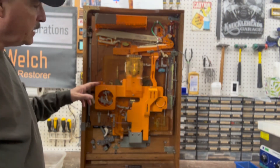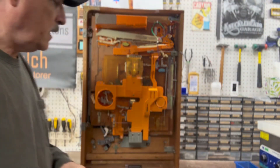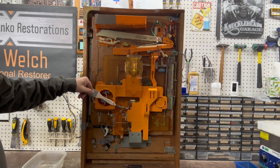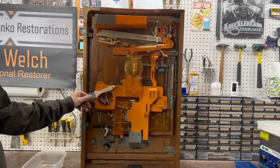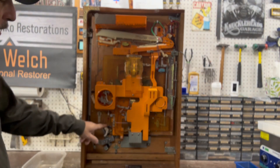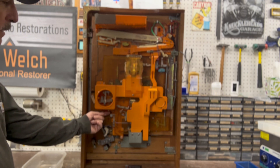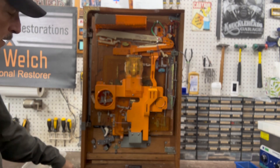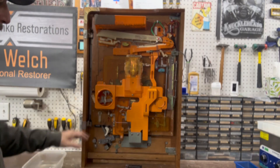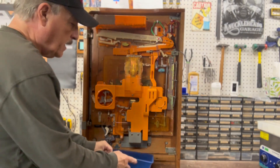Once it's full, make sure the seesaw is tipped the right way. If the seesaw — which is in here — is tipped this way, it's incorrect; it needs to be tipped that way for proper working of the machine. Right here is a little red arrow and a plunger — you just push up and it brings the seesaw from the wrong position to the correct position. Make sure that is set.